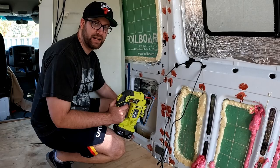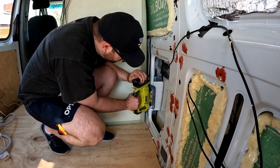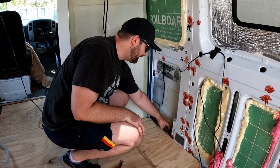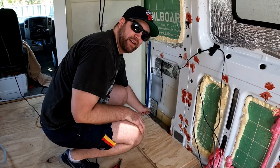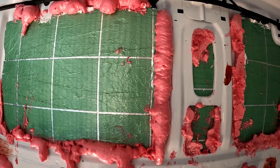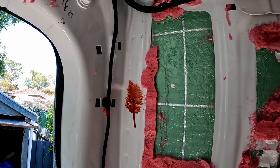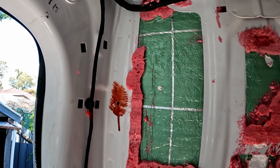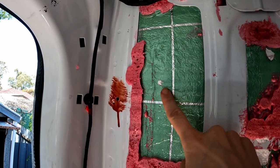I'll cut into them and make this side all nice and neat before I measure up the outside. I'm probably going to have to put in a baseboard — I don't want to cut into this layer right here, so this will give it a proper base to actually sit on, nice and flush with the edge. We're going to go over that and get rid of all the burrs with a file, then start prepping the outside ready to slide it in. One little tip for what not to do: it's been a while since we originally put our foil board in, and while we've been using the van for other things it has gotten some little tears in it — which is pretty much what you don't want. So if you're using this product in the future, remember to cover it up quickly before it gets damaged.